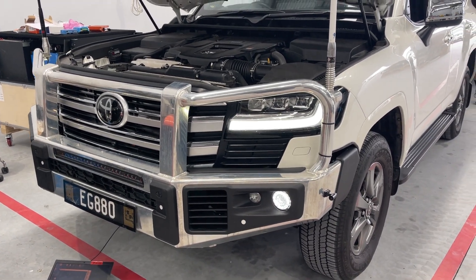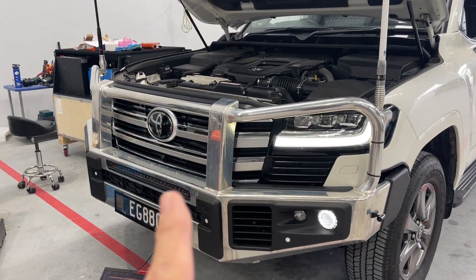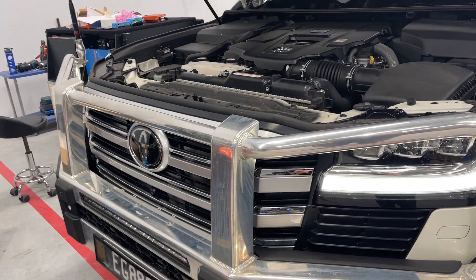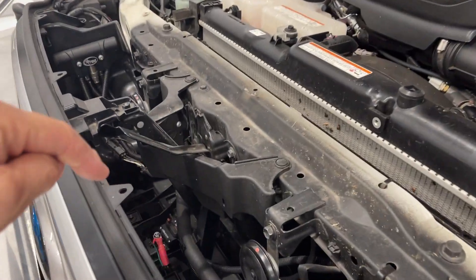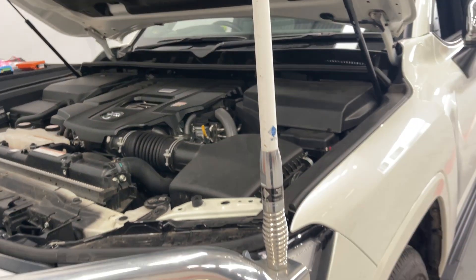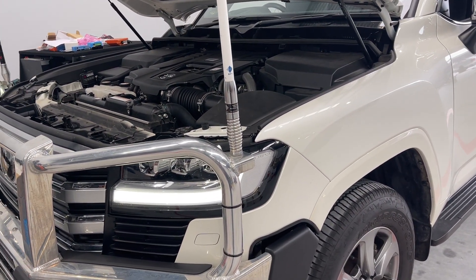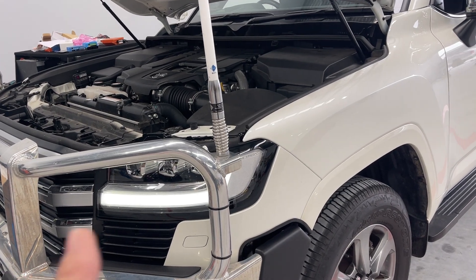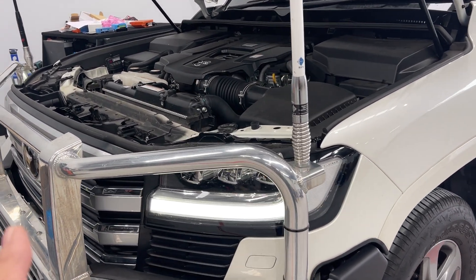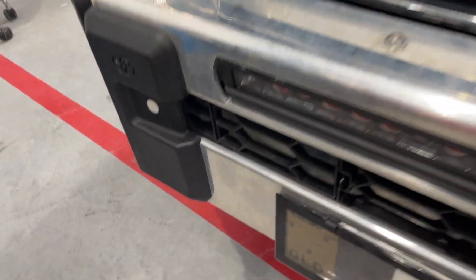Hi, Bruce from Safari. This is part two on charging the silver line and I'm going to show you inside this time, but first explain about voltage drop. This is a technical video for those that are interested. We've got the Scotty down the bottom there, we're idling now. The install in the vehicle was done by another party, not by us. They used a 16 millimetre squared cable. It is 48 volt but we're now running up to 100 amps, and at the moment on the screen here I'm seeing 53 volts at the set point.